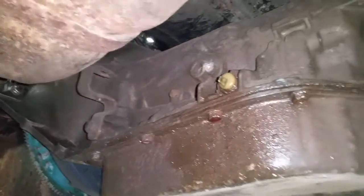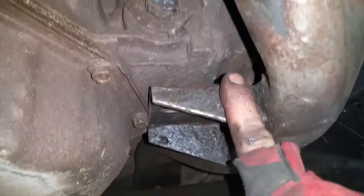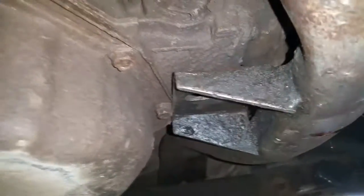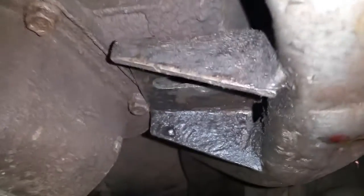I've been tinkering away a bit on the race car here. I've got the transmission sitting in place and a problem I came up with is the cross member isn't quite going to fit. So I think if I cut this off and move the transmission mount forward to where it can line up with the holes here properly, then what I can do is weld the mount back on here and I think it might just work out for me. So it's going to be something I give a try later.